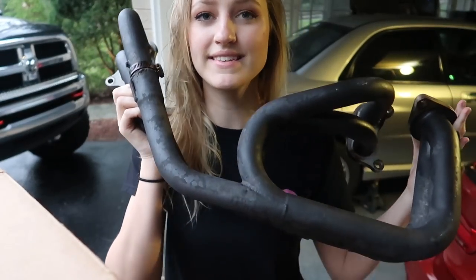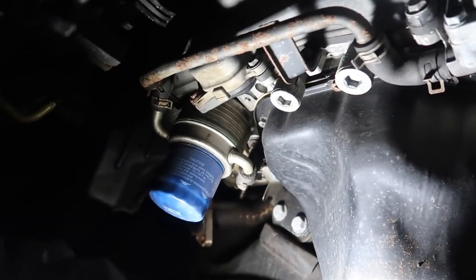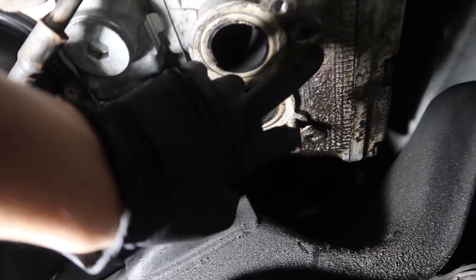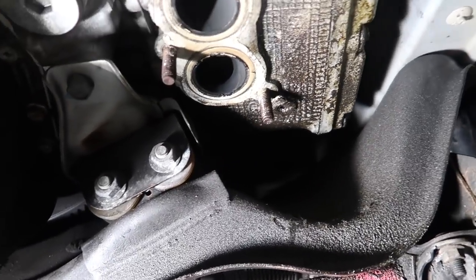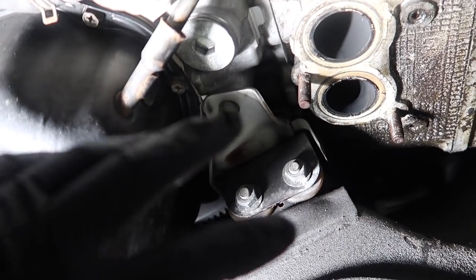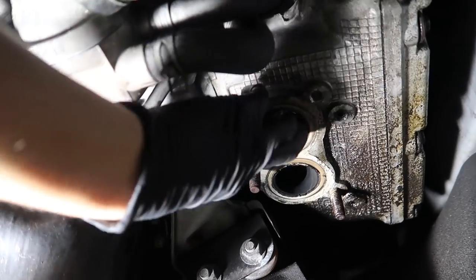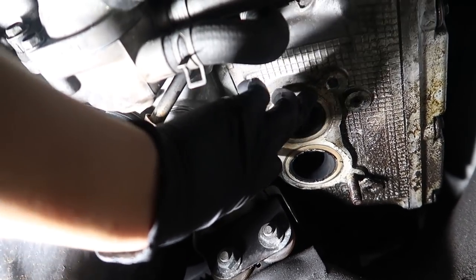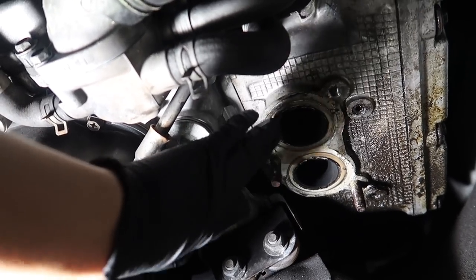We're gonna take off the up pipe, do my valve cover gaskets, and then get to heat wrapping. Underneath here is my oil filter, my oil pan — this is where the header will go. You can see all up in here all this black stuff — this is all oil. It leaks down here under my sway bar, so this valve cover gasket is bad, which is why I took off all the heat wrap originally. Now I have time to fix this, get it all cleaned up, and install some good stuff. It looks like the previous owner also put some gasket maker or Honda Bond here, which I'm told is unnecessary, so I'll clean this off before installing the new gaskets.